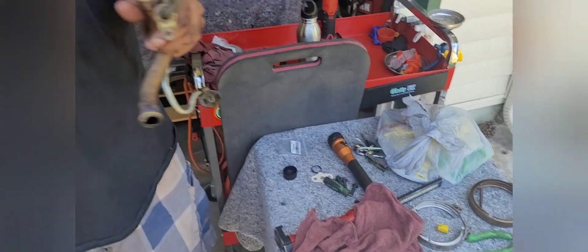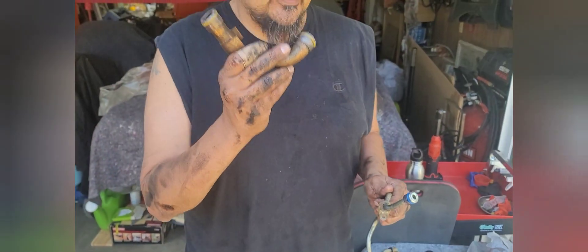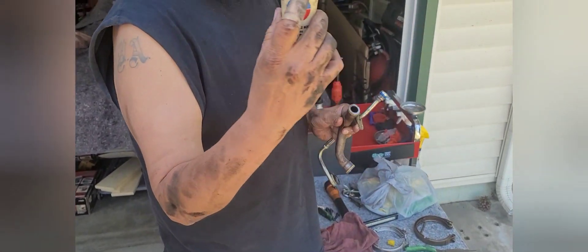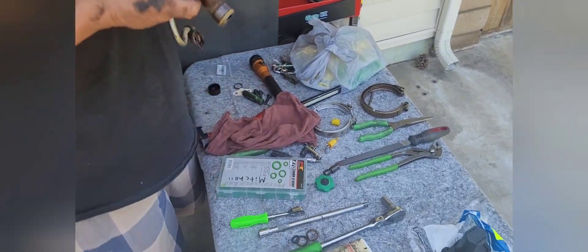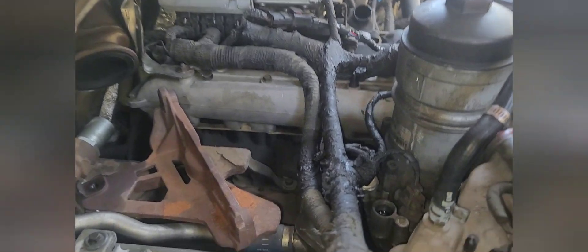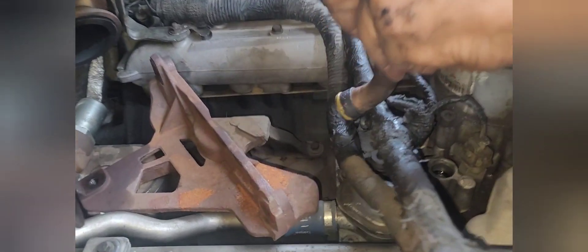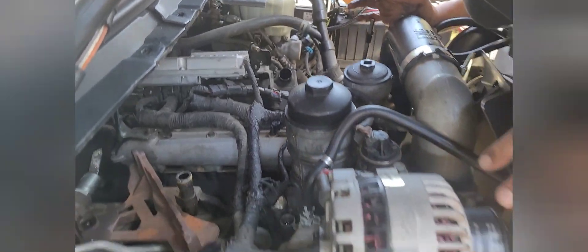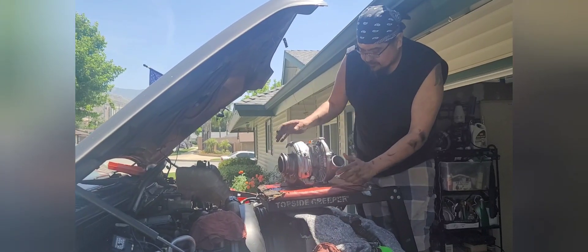Going back together now. We've got the turbo oil drain and the turbo feed tube — I replaced all three O-rings on them. I lubed them up with a little silicone lubricant — it says brake lube but it's silicone. Now put them back in. You want to get these tabs right here — they go over this. The drain tube is going to sit like this and the O-ring part goes into the hole in the high-pressure oil pump cover. Play with it a little bit until it goes in. We've got to set the turbo so yeah, set the turbo on and fasten it back up.